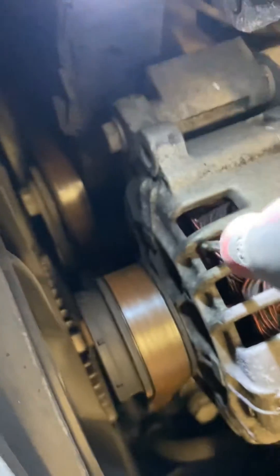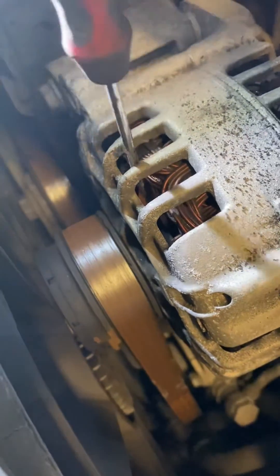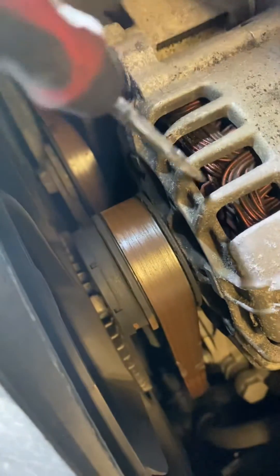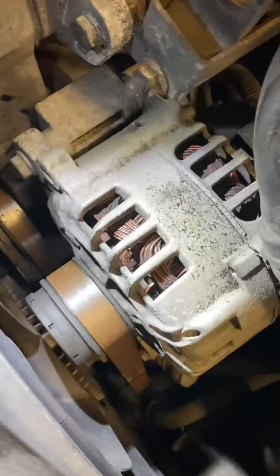There we are — you can move the fins that way. It won't move that way because it's a unidirectional clutch, but you can move it the other way. And that's a quick and easy way to test if your clutch pulley is working without having to disconnect the alternator belt, just finding out if it's in good condition. Catch you later.